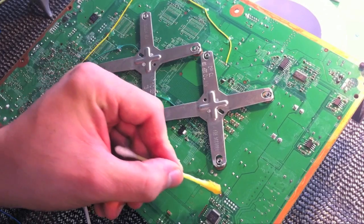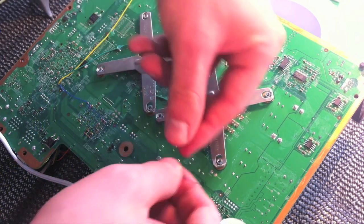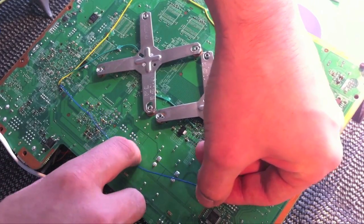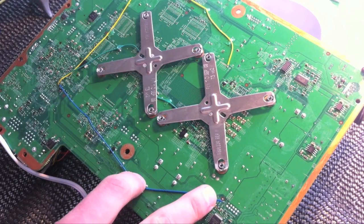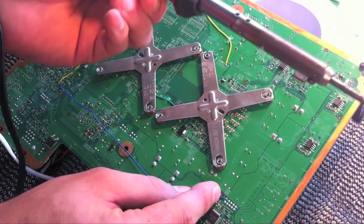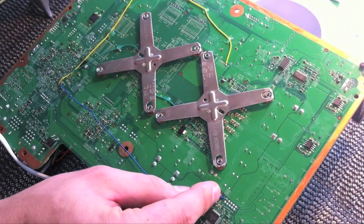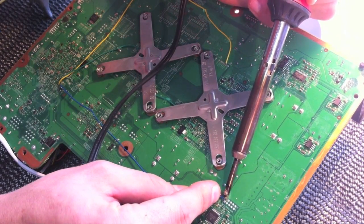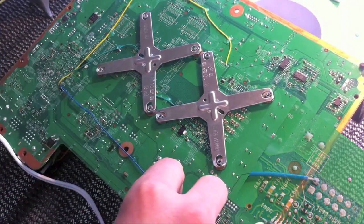On to the last one — the blue wire. The blue wire is the easiest. Run it straight right, but try to avoid the area here by rounding the wire around it. This wire will be soldered onto the D-point on the TX-Wiring diagram, which has a number 2 right next to it. That's it — all the hardware is installed.